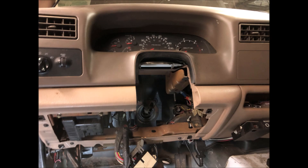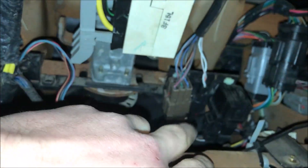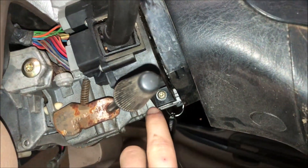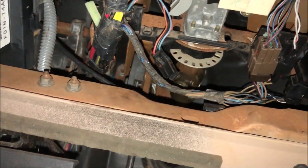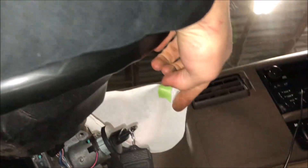Another big thing I did — this is a completely different steering wheel and steering column. It's a manual steering column, so I took the automatic one out yesterday. It's really just four nuts and a bunch of wiring. These two plugs need to be disconnected, this needs to be taken off this mount, this needs to be disconnected, and it needs to be disconnected from the steering shaft with that 10mm right there. After that it should pull out.